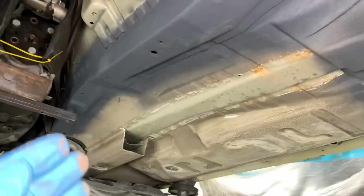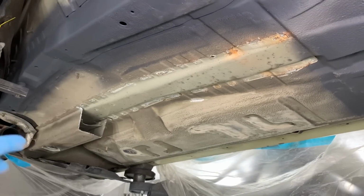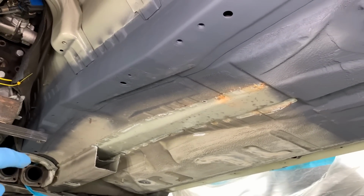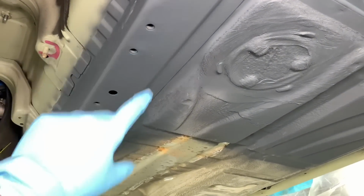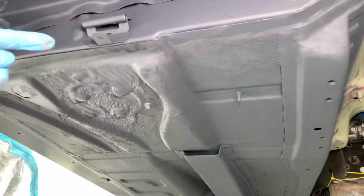That isn't the full chassis leg, that's just up to the area where it turns into a double skin, which then means it's nearly impossible to re-weld it correctly again. You'd have to chase the whole panel out, which goes all the way up to the bulkhead behind the engine area. Then you've got this panel here, which normally has corrosion on the edges, which is the transmission tunnel bracket. There's one on the left, there's a chassis leg on the left. Then there's panel overlaps everywhere.